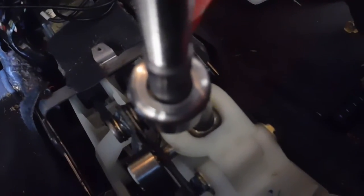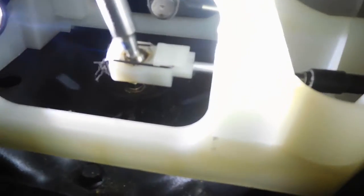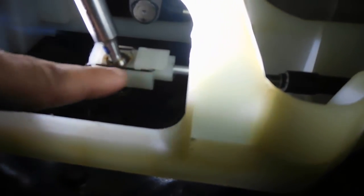There's an allen bolt on this side which I forgot — I need to get an allen wrench. You move this bolt here and this bolt here. These are the four bolts for the carriage, which you do at the end. Then you remove the old retainer. It's not going to come off past this piece, so it has to stay on — that's why I need a new one. Taking this bolt out and this bolt out loosens the shift retainer. Then you can take the linkage off. Once you loosen these, the linkage will come off — there's a snap on the bottom and a little spring you have to release, which makes this come out of the socket.